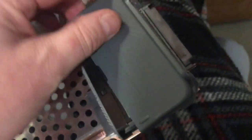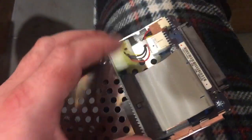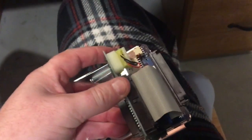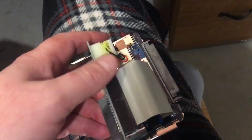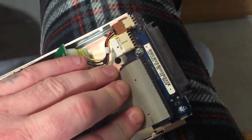What I'm going to do is remove this — I popped the cover off the drive thing; you just squeeze the sides, lift up, it'll fold over, and this piece comes off. I unplugged the IDE hard drive of course before I did all this. This is just a standard 4-pin Molex. This cable was folded up because of the IDE. You usually have to take this off to put the drive in anyway, so stretch it out a little bit.